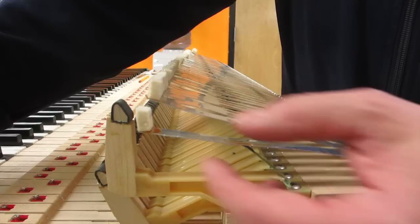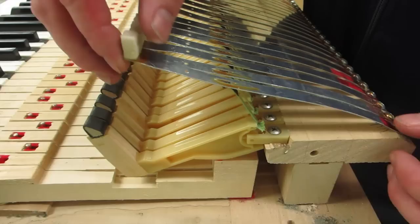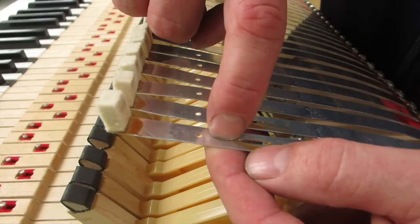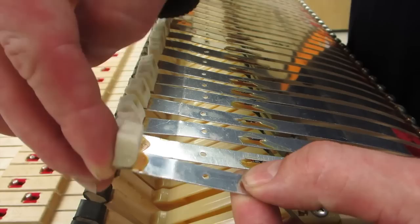So you may at this point decide to put new dampers in. And again, if you decide not to, there's those tricks, and there's also a crimp that you can add, almost like a V shape. You'd just sort of bend, think of a small channel right in there, that can help stiffen this section to prevent it from overflexing on those heavy strokes.